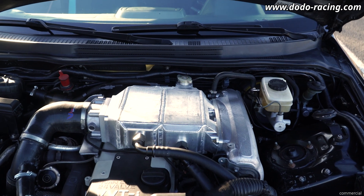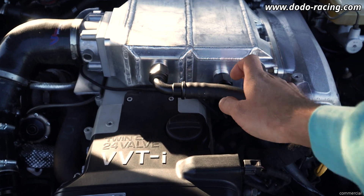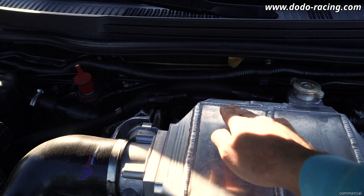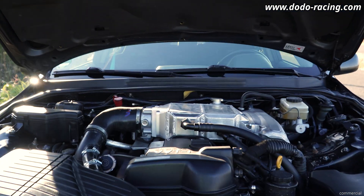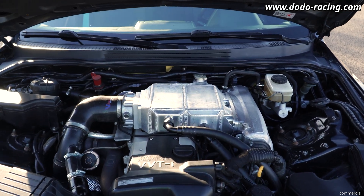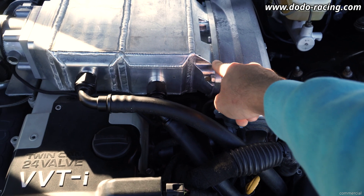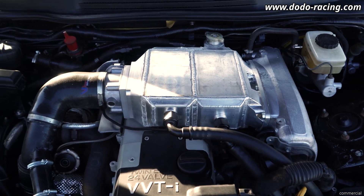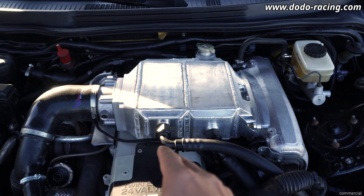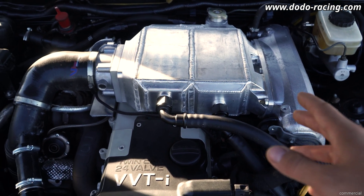Let's talk about some changes I still want to do on this setup. Of course I want to space these evenly. The filler cap will be on this side because it's the highest point — we have a slight angle on the intercooler as you can see. What I really want to do is some kind of quick release mechanism, because if you have the single core variant you can just pull the throttle body to access your coils, but with the dual pass variant you have to pull off the whole intercooler.